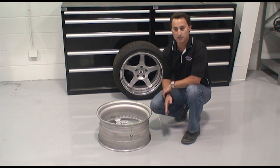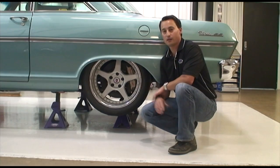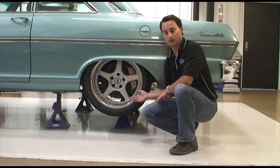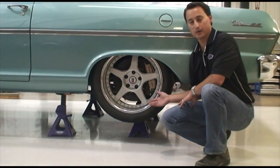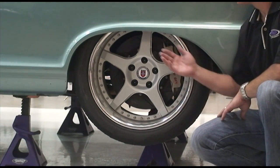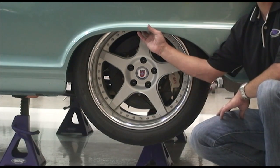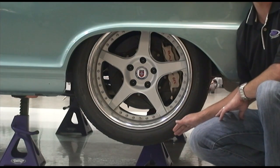It also adds strength, as you're keeping the center of the wheel in the middle of the wheel hoop. As you can see on our DSC Chevy II test car, we have correctly fitted our HRE wheel to the vehicle. We have narrowed the rear end so that we can run a shallow backspace to achieve that classic custom look on our wheel. We have also minimized the clearance on the inside and the outside to maximize the BF Goodrich KDW tire size under our vehicle.